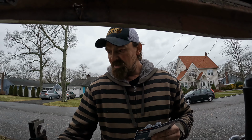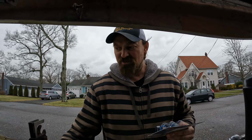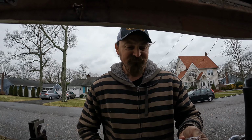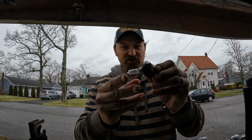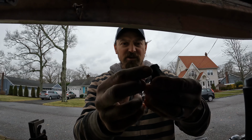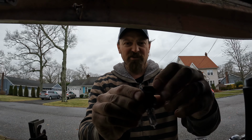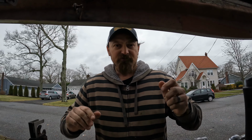So the headlight glass, or the plexiglass or whatever plastic covers, they're still clear, so they're good. Nothing wrong with that. We're just changing bulbs, easy peasy. So this is the old bulb, and there's the connector. It's got 3 connects, 2 on each side, 1 on the back, and then it's got 2 metal pins and 2 plastic sleeves. So that's what we're going to be changing out.